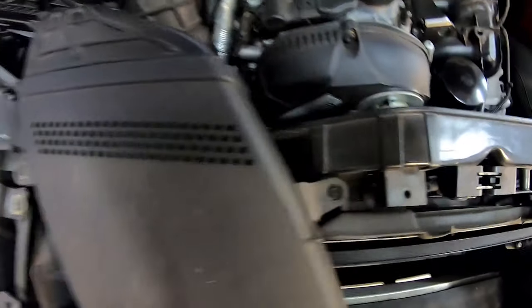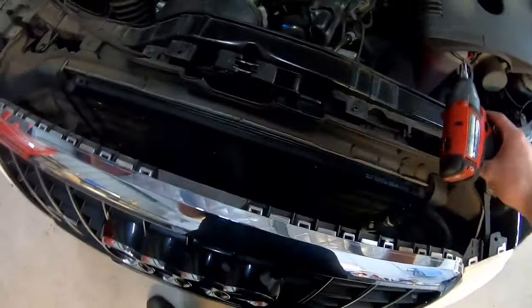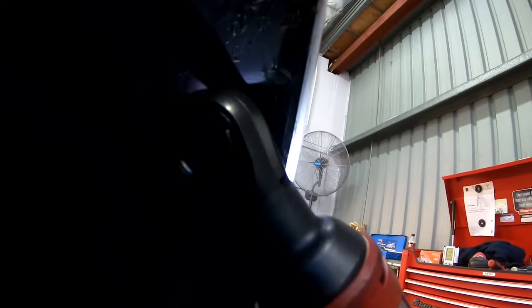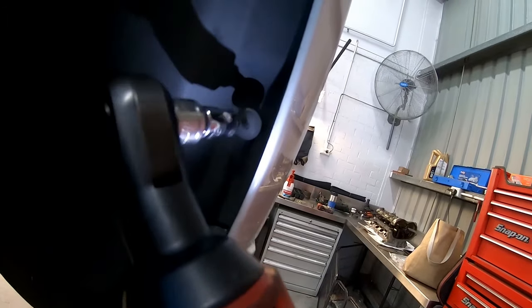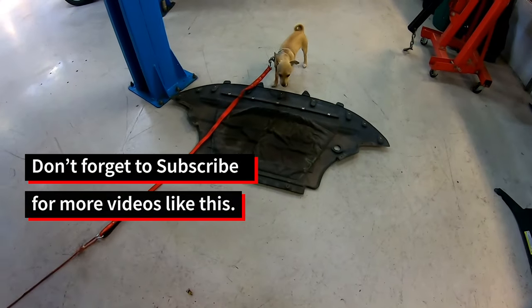These two T20s need to come off so we can pull this shroud out. The airbox shroud is up here and I want to get these T20s down here. Each side just for the bumper to come forwards - we're grabbing these T25s in the wheel arch liner, each side of the bumper, one up there as well. Once we've got those out, down there as well, I can then pop the bumper. We'll get the ones underneath as well. Under tray's off and we're just going to start pulling these bolts here.